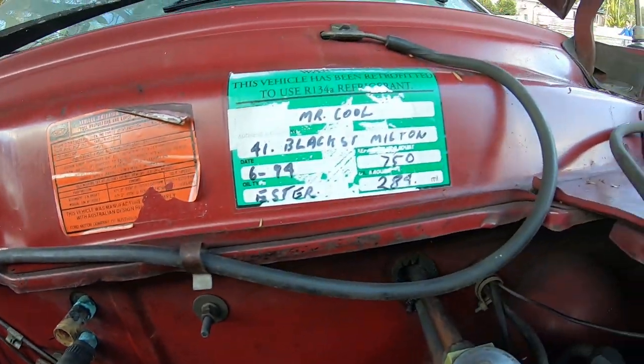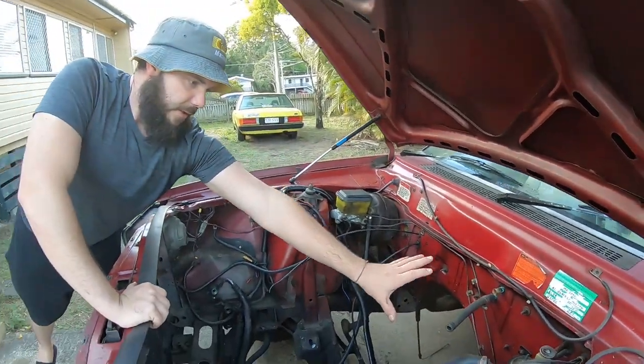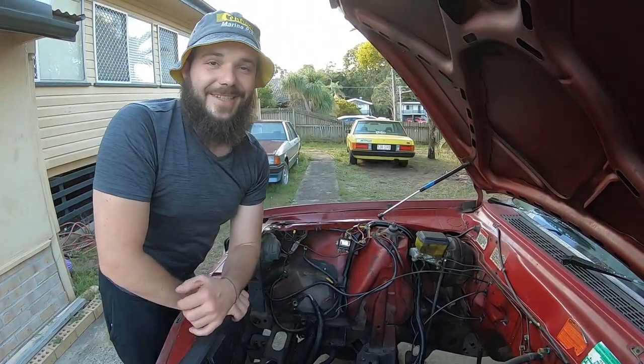We have to pull the dash out of this car because the wiring's absolutely a nightmare. The plenum — and then you're checking the rear firewall lip there; very important, as that can be really annoying to fix. But this is absolutely mint. Check the firewall for any dents or hits. You can eyeball the chassis rails when the engine's out; you can really check it out.